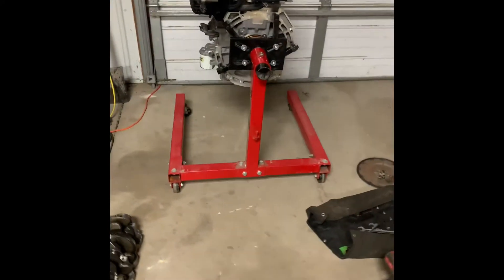I posted on the Mazda Speed 2.5 swap page and they said you could run boost on stock internals, but it's not the best thing to do. The ring lands will blow out if you put too much boost to it, so I think we're just going to try to use stock internals and just turn the boost down quite a bit and see how long it runs.